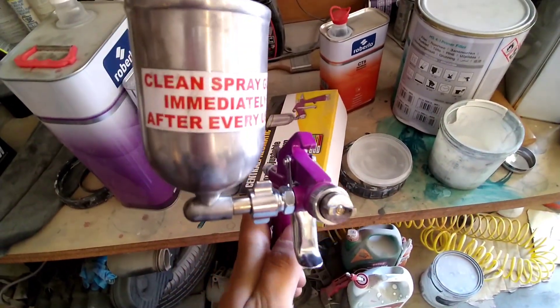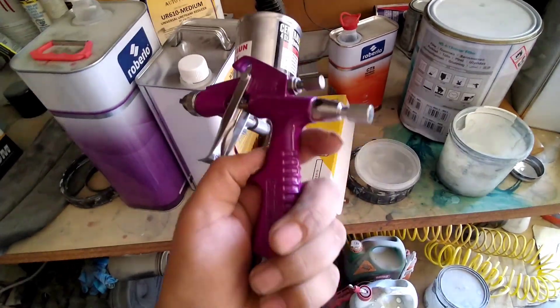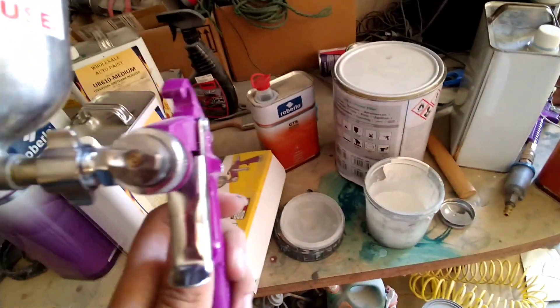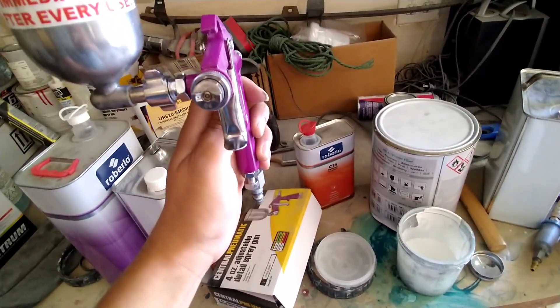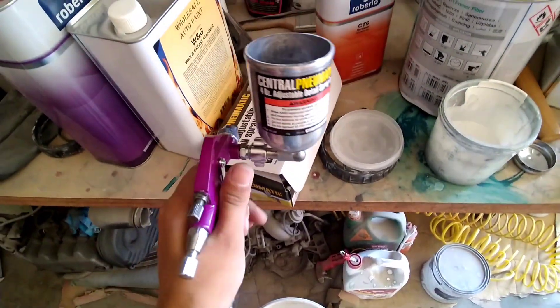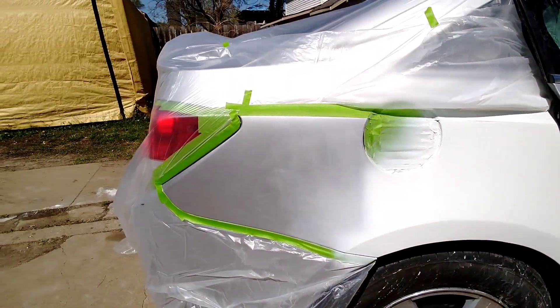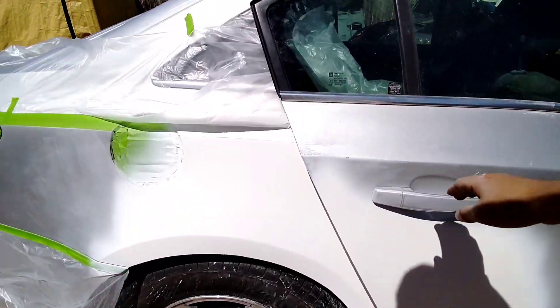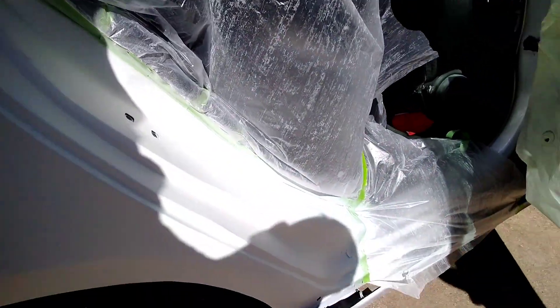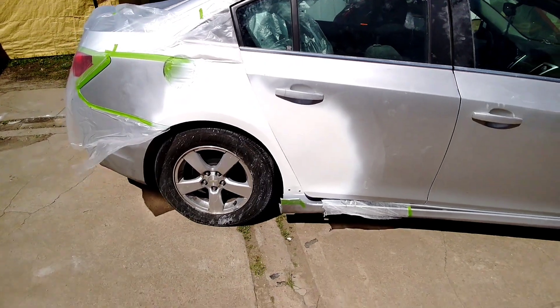Alright guys, we went ahead and put it together. It says clean spray gun immediately after every use, which I do — so that doesn't change anything. Same plug for my compressor. When I went to mix the primer, I noticed our gauge right here is 0.6, which means it takes thinner primer, so I had to make it a little more thin. That's good — it should just be able to go up there with gravity feed. There you go — went ahead and did the primer. Thick primer. We still got a little bit of drips right there, but wet sandpaper will get that out. It's all ready to go for paint. We just gotta wait for this to dry and then we can start doing the top coat paint and then clear coat.